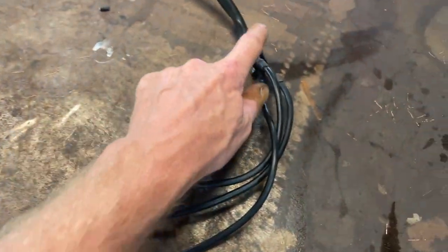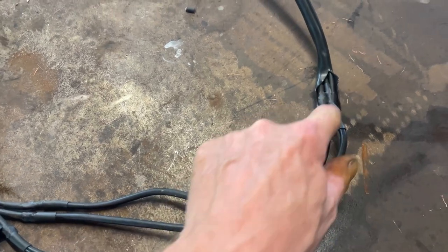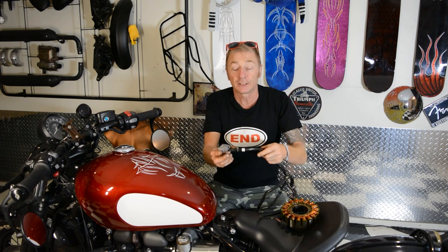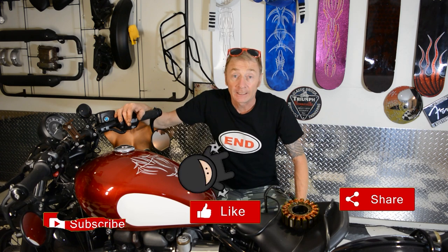So I've lengthened the wires, soldered both ends so the oil is not going to get through the middle, and that end is sealed as well. This bit is going to be above the gearbox, so gravity is going to work against the oil leaking too. Hopefully this will sort it out, but I think even just sealing this end sorts it out anyway. I've got a longer lead on it which goes over the gearbox now. I'm probably going to make a shorter video just about sealing this end because this video is quite long-winded and you probably don't need to go through that amount of trouble. I don't know if it's going to work yet — it's got to be on the bike for a while. Let me know what you reckon, don't forget to like, share, subscribe, and have a great day.